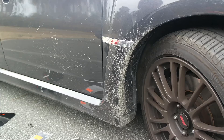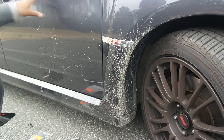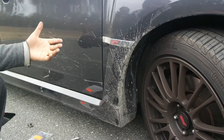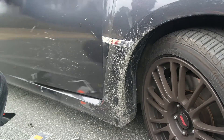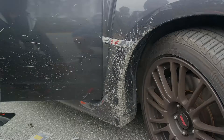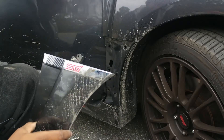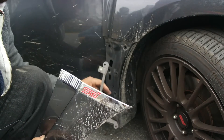Before pulling off these parts, make sure that the doors are open so this part won't hit your door and mess up the paint. The reason I took this off is because this piece has to go up against here, so you're going to need all the clearance in order to get it to work.